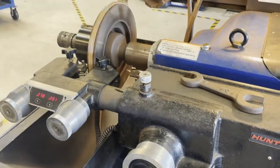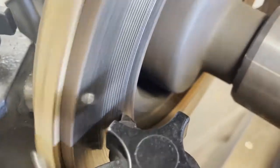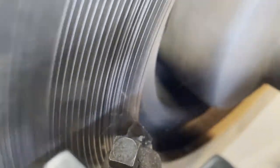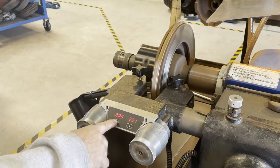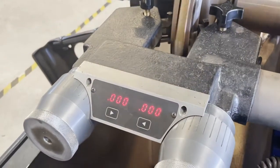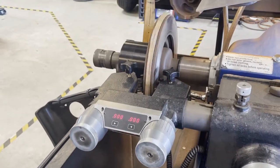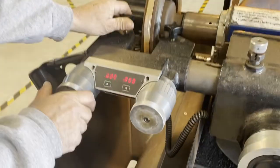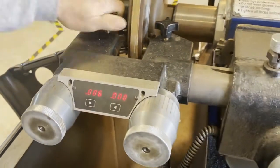This machine starts in the center and works its way out. I'm going to run this in manually all the way. You can see there's a little rust ring on the inner edge — I want to make sure I take that off, same thing on the other side. We're going to zero out our scale to measure how much we're actually taking off. You don't want to cut more than ten thousandths at a time — it'll dull the tips. I usually cut six thousandths. The idea is to take off the least amount of material necessary to clean up the surface of the rotor. Make sure you lock these black knobs down so it doesn't come out of adjustment.